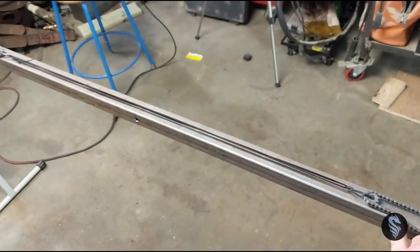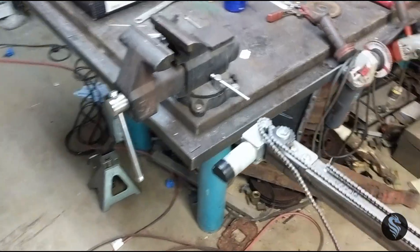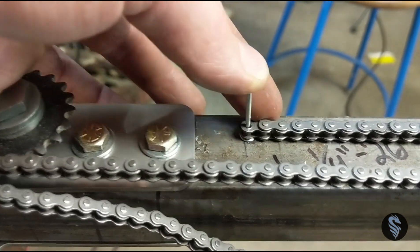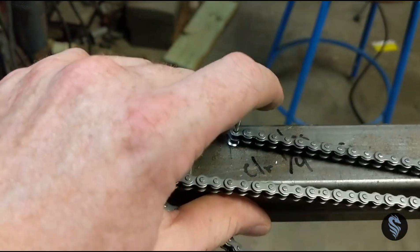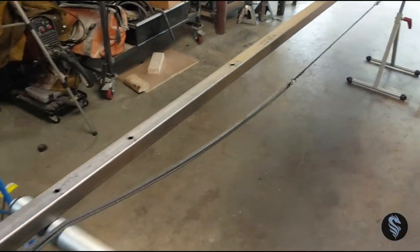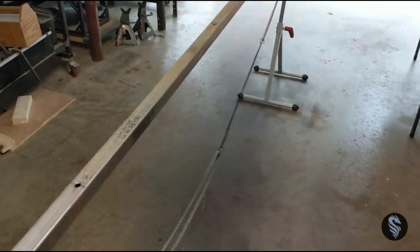For tensioning right now, I took the original stock bungee and I have it run between the two chains — it's tensioning up pretty well. The only thing is I've got to figure out an actual method of securing the ends of the chains, because right now I literally just have an aluminum pop rivet drilled into an eighth-inch hole that I threw in there. I'm thinking maybe a bolt or something to give me a more permanent solution. I just knocked that loose and they're now dangling in the breeze — yeah, I don't like that. That just popped off the rivet. All right, I've got more work to do.